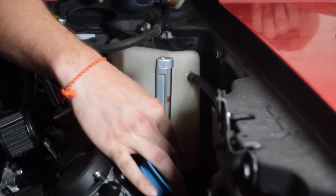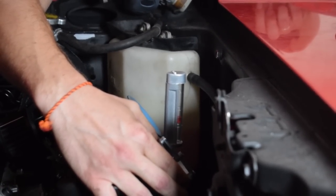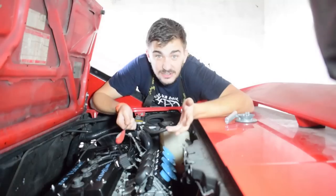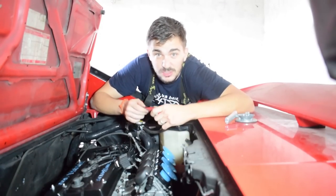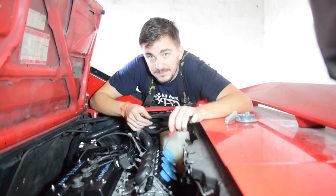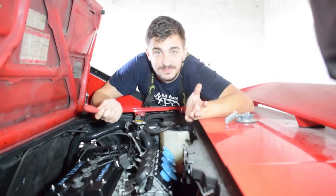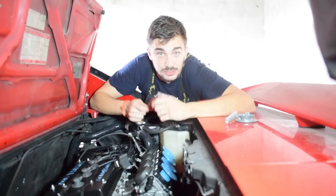The Unison is a really nice tool — I got it on eBay and there's a link in the description. It's honestly pretty cheap and makes the job a breeze. And there you have it — probably the single easiest thing I've ever done on this car. The most complicated part was modifying a screwdriver so it could reach deep enough between the carbs to turn the little adjusting screws. A simple little job with an elegant solution.